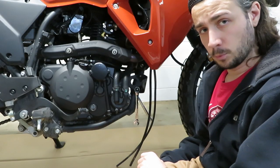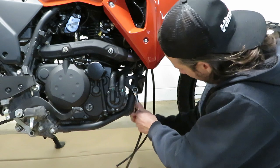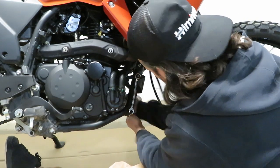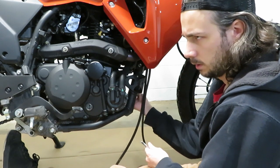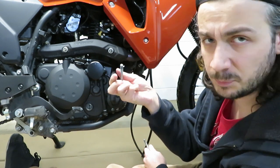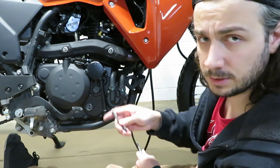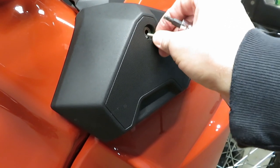With the skid plate removed, the next thing I've got to do is remove the front two motor mount bolts that go through the frame. We do have two other motor mounts - one in the back and one up top - so this shouldn't shift around too much. Top one came right out. Bottom one was kind of hung up - seems like it was just caught on the threads, so spinning and pulling got it out. If yours is so stuck that it seems like it's mashing the threads, get something underneath and reposition so it comes out clean. Don't lose your little nylon washer.